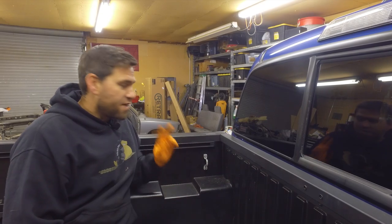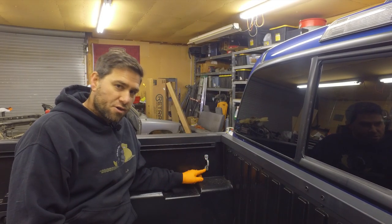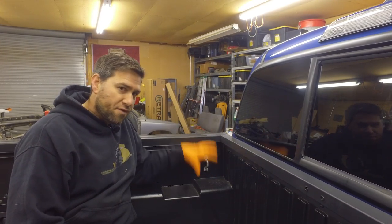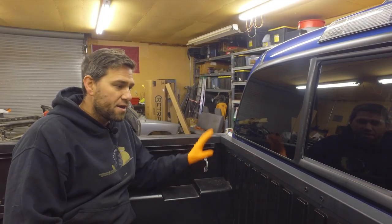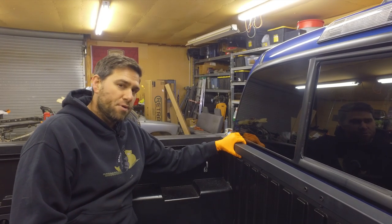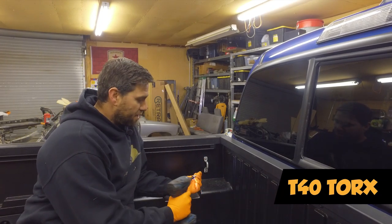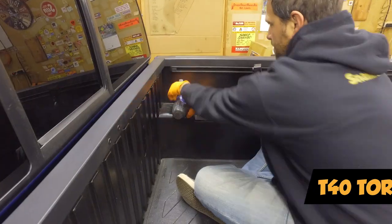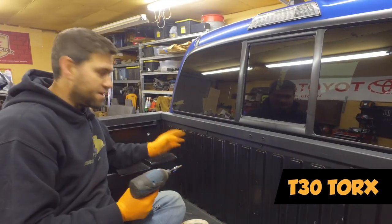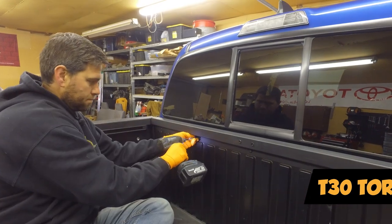To start, we've got two operations inside the bed. First, we have to remove these hooks in this area because the box and assembly is going to fall down in here and this would be in the way. Second, we need to pull off the pieces at the back part and put on some foam blocks. Pulling these off first — it's a T40, just zip those off. Then with a T30, we're going to pull off these five Torx bits along here so we can take off this top plate.